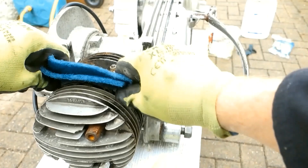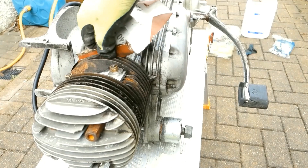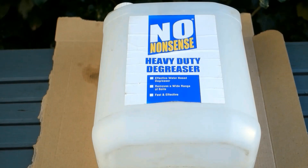Then second pass was neat and hosed off. In the absence of a wire brush, the pads when wet and doubled up are not bad between the fins. Likewise, sandpaper doubled and redoubled. I may spend some more time on the cast iron fins and then spray them black while they're visible. This stuff — No Nonsense — I used it to clean the engine, so I'll give it a quick review. It worked well enough for what I used it for, so no complaints.